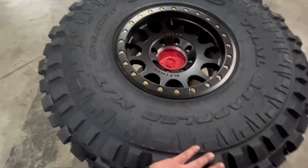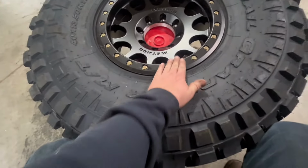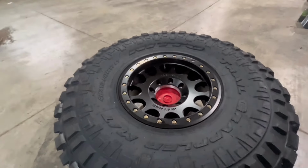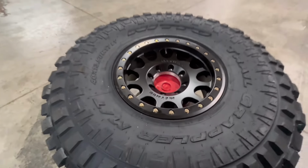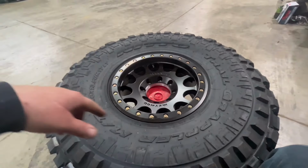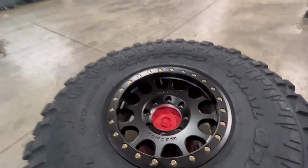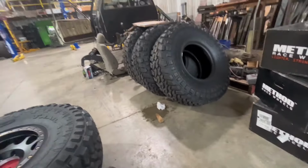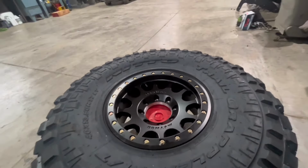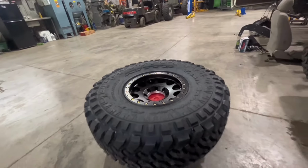Okay, all torqued, anti-seized. Looks like 22 foot-pounds is what they're calling for. Went around the thing like probably 4 times before it all came up to torque. Or you know, it'd come up to torque and then I'd go back around because tighten this one and this one gets looser and so on. So only 3 more to go. We're gonna air this baby up. And I wanna roll it next to one of those 43s and see how they compare.